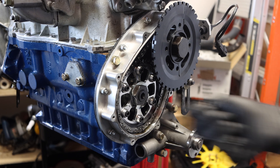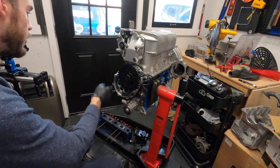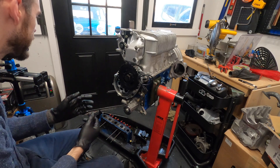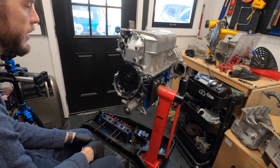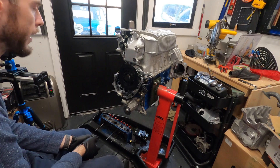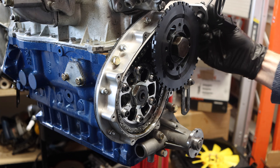In my setup, that's not going to be an option because I have this enclosed on the back here. If I were to simply pull the camshaft out now, all of the tappets — all those lifters — would fall right down into the sump, and then I'd have to take the gearbox off. I'm trying to avoid doing that because I don't want to tear that apart and have to replace the gaskets and the transfer case.